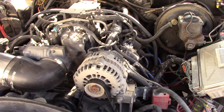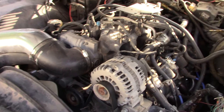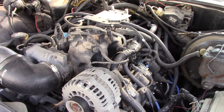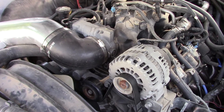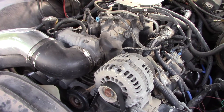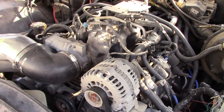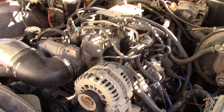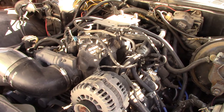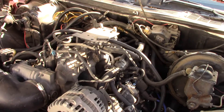The motor has over 300,000 miles on it — does not make funny sounds, does not smoke, does not rattle. Whoever had the Tahoe prior to the transmission going bad took care of it. I pulled the oil pan and put a Holley — I think it was a 302-2 oil pan, but don't quote me — a newer version of the Holley pan, to make sure it cleared everywhere. I used all the truck accessories and LSX Innovations adapter plates for the motor mount plates. I set it back to the factory Turbo 350 location. The motor had to be set so far back I can't get wires shoved back here — you've got factory wires I didn't want to cut, and the truck wires too. It's tight, I'm not going to lie, but I've got plenty of room up front.